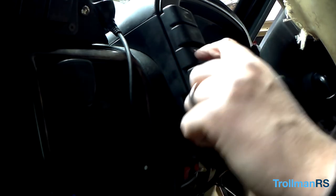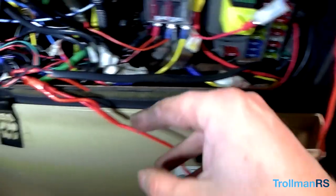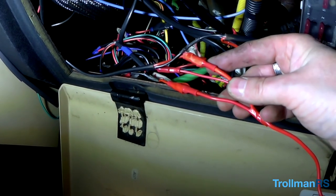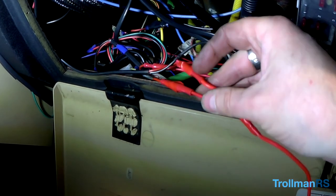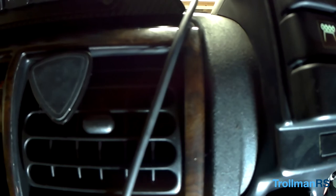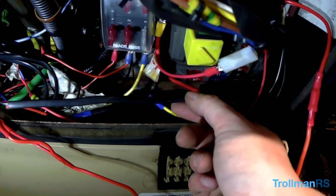On, off, on, off. Right, I've just completed the wiring. So this is the trigger feed from the high beam. All right, and then I've split this into two. If you remember from the previous video, one of these feeds the spot lamps on my front bumper. So I just created a spur off that one, and that goes up to my switch to enable the roof spotlights. And then the wire comes down to here, and this goes to the relay under the bonnet.